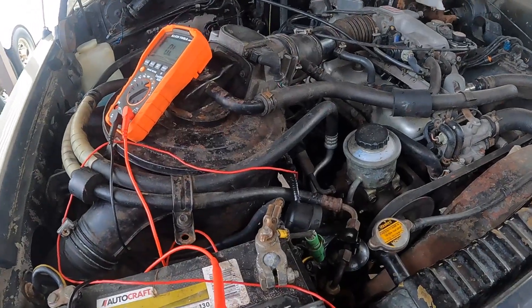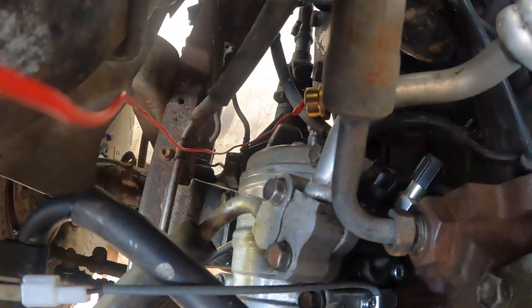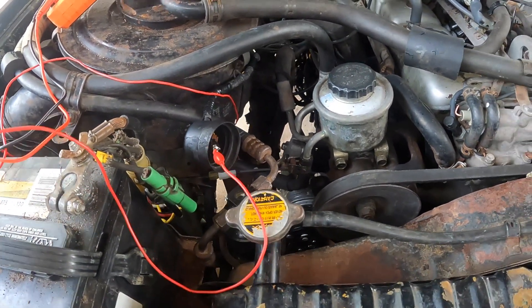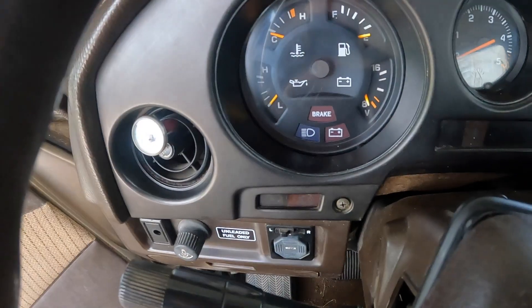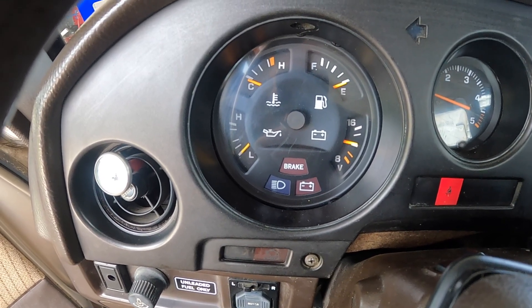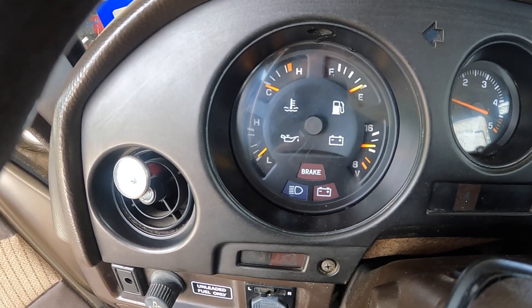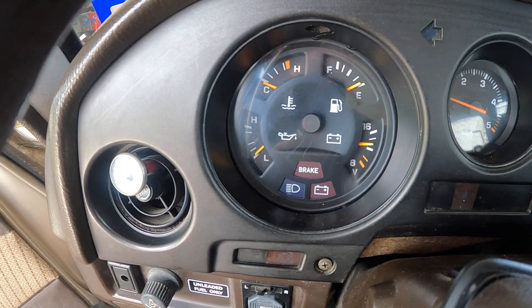Now let's troubleshoot the wiring. I hooked up the wire with my red test lead and down at the sender it's still connected — this simulates that it's wired up as it should be, only adding the small resistance of this little wire. I want to show you what it's doing on the dash. Here we have our oil pressure gauge. We can see it's going directly to ground, and it did raise up a little bit on the gauge, but not all the way.